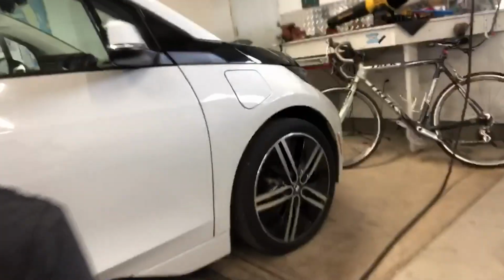So we're here in the garage, Gidget's helping out right there, and we're wiring up this cart. I know it looks like a disaster at the moment, but I'm having a lot of fun with this build. I'm having to do like an hour or 2 every day just because I have, obviously, real estate to run and all that other stuff. Right now, we are putting in the DC to DC converter. What that's gonna do is take power from our battery packs, which are right there. Those are out of a Honda Clarity Hybrid. It's gonna take power out of those, which is 48 volts, and convert it to 12 volts so we can run lights, radio, all that kind of stuff. So I'm laying everything out, trying to get it drilled, all new hardware, all that kind of stuff.